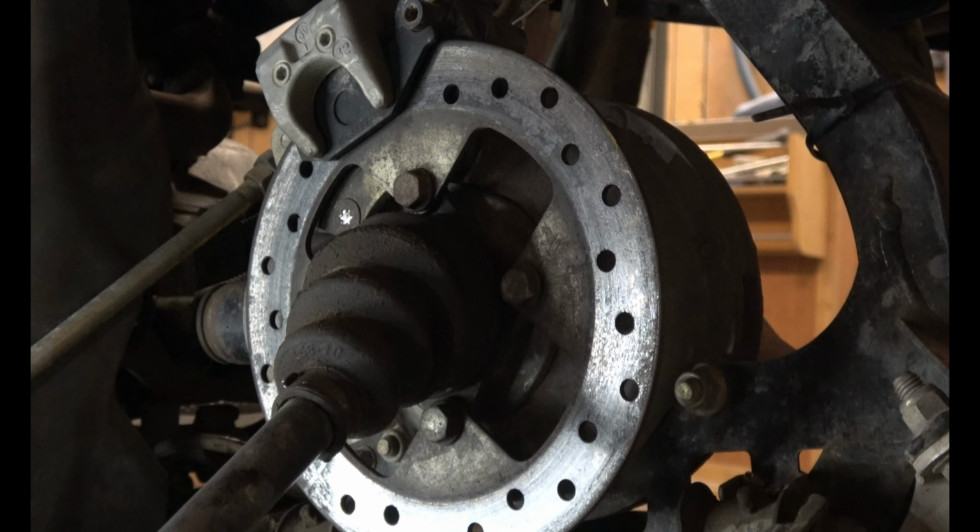Now with a bigger spring setup for a car, let's say, this spring would just come off now, but it's binding on certain points, this stopper and possibly the shock here. So now you've got to loosen this all up, take the spring off, and install it on the new shock. Place the spring on the new shock, pull the shock center up, push the foam rubber stop back down a little bit, place your spring compressors back on the spring, install the retainers, and tighten it down.